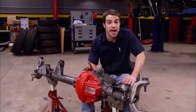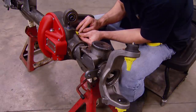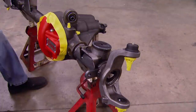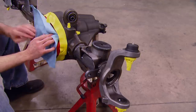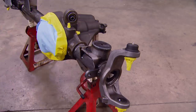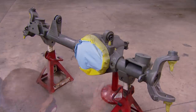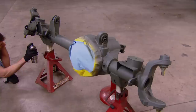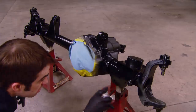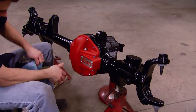We had them fill this one with a Yukon Gear and Axle 5.13 ring and pinion set and an ARB air locker. To finish this thing up, all you gotta do is paint it and add our factory steering knuckles. Since we only want to paint the bare steel portions of the housing, I'm masking off everything we don't want painted black. I degreased all the bare metal surfaces, then followed that with a few coats of Duplicolor self-etching primer. I kinda dig the green, but it doesn't really match up with this project, so I'm giving it a bath in semi-gloss black.